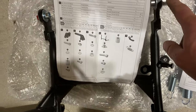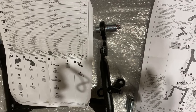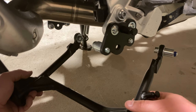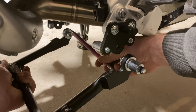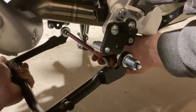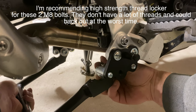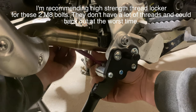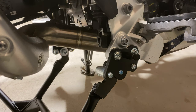I applied grease on both sides — you'll see you have some excess grease here. Get rid of that. You're going to need to use some Loctite to get this tightened down, so when you're installing this, grab your paper towel and clean the excess grease off the end of these threads. Let's get ready to install. Given how low this 750 is, this is probably the best angle I can get for you guys. There's our empty hole right over there and another empty hole right here. So I'm putting the center stand in carefully. I've got my long M8 Allen. Grab this one and go ahead and thread this in — just a couple of turns is good. Screw that in. These are supposed to go to 40 newton meters, but I'm not going to tighten them down just yet because I want to get the spring in place, so we're just going to lightly tighten them up.